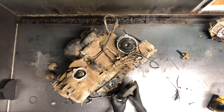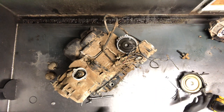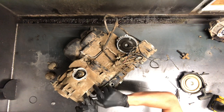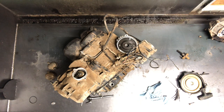We've got the recoil pull starter off here — that's four 8 millimeter bolts. And then we'll pull the camshaft. Once we get that tensioner off, there's no more tension on this chain, so we're able to pull that cam sprocket off.